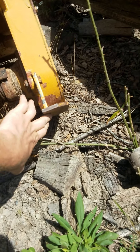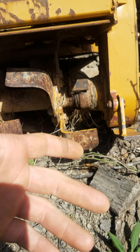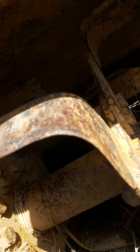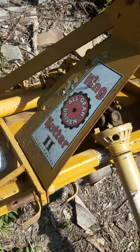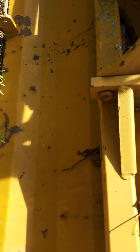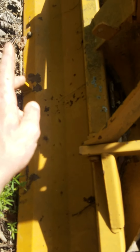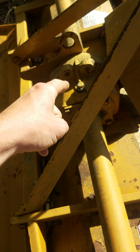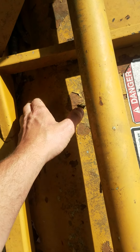Check your shoes — if your shoes are all bent up then nine times out of ten they've dragged it across a lot of rocks. Check up in the shoe: this isn't the thickest metal, you can bend it with your finger, and you can see big dents if they've gone through a lot of rocks. Another good thing to check on these is the tailgate — see if the tailgate's been bent up. Check your gear oil and all of that stuff. Check to see if they took the time to clean this stuff out.